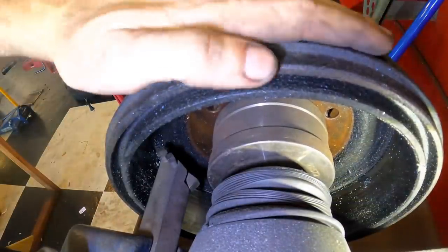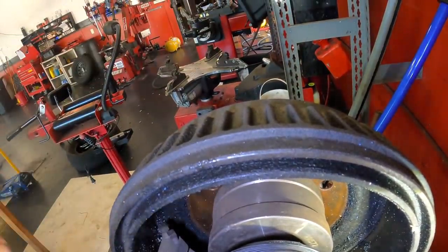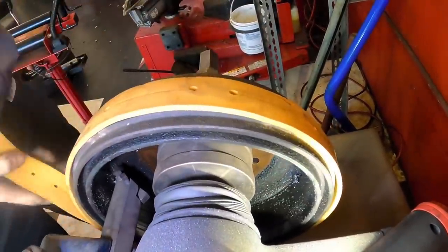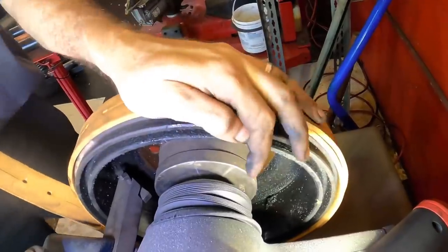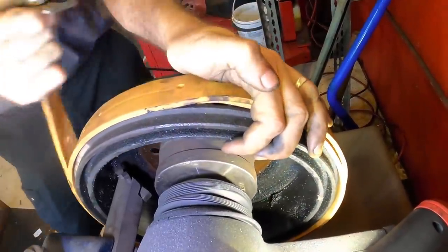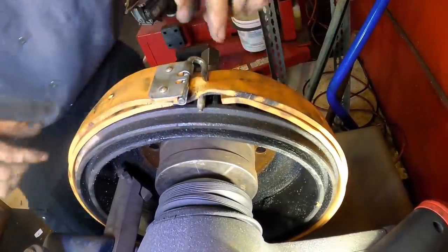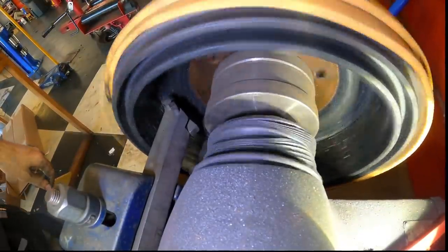But we're not ready to cut yet because we still have to install the vibration dampener, a giant rubber band, on this drum because it will vibrate harmonically and then cause imperfections in the cut. And that would be bad. Go ahead and set this up. This thing hasn't been unpacked in a while. It's permanently molded to the roll that it was shaped in. Man, this thing's old, it's tearing. Just because it looks new doesn't mean it's good, but it should work for now. So we're good. Let's go ahead and fire the lathe back up, powering on.